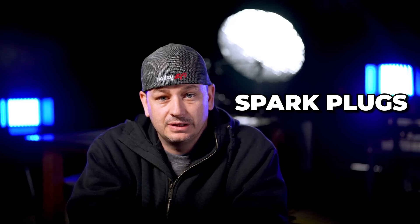Number 13: depending on the use and power level of the car, the spark plug situation should be part of the pre-appointment conversation. Talk to whoever's tuning about how many sets of plugs they want you to bring and who will be changing them. Most importantly, don't drop your car off with plugs that are already fouled and dead — if you demolished your plugs getting the car on and off the trailer, let the tuner know ahead of time so you can put a fresh set in rather than dumping that job unexpectedly into their lap.